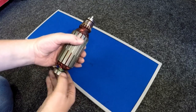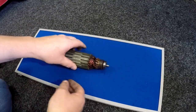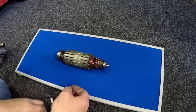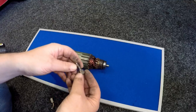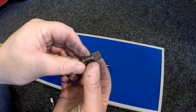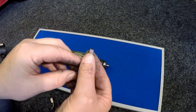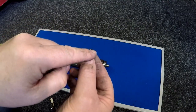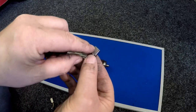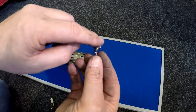What we have here is the motor commutator. When we were on site, we had a look at the brush top unit and took it out — slightly worn as you can see. It's a 43×7 by 11. That was the top side, slightly worn as well, more on one side than the other, and that's where it's sliding through the brush unit housing.